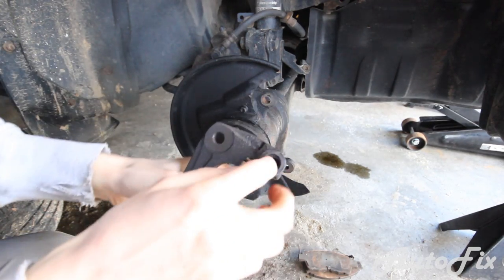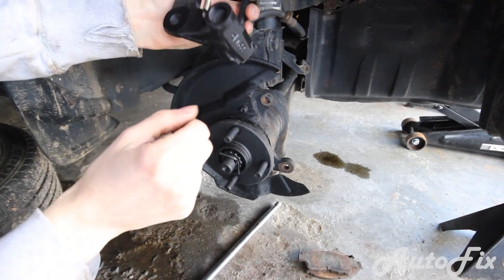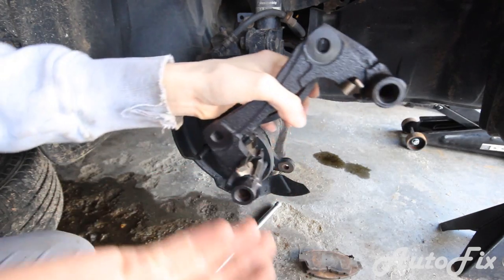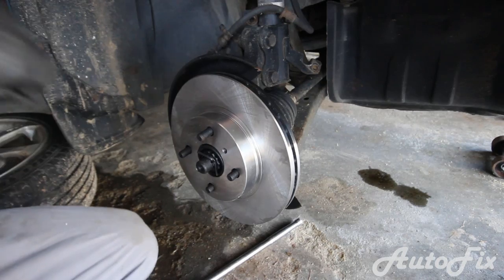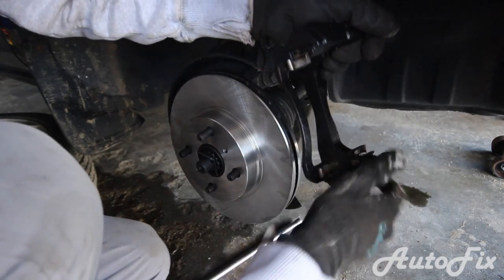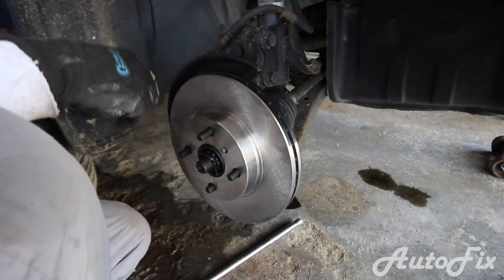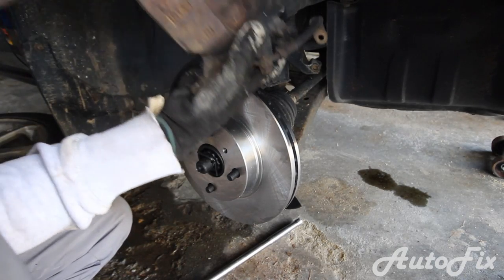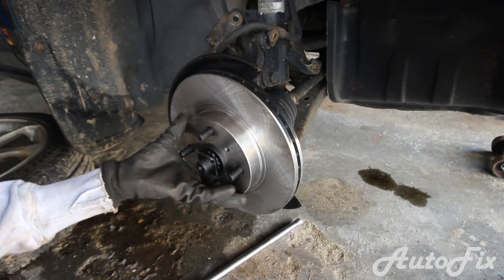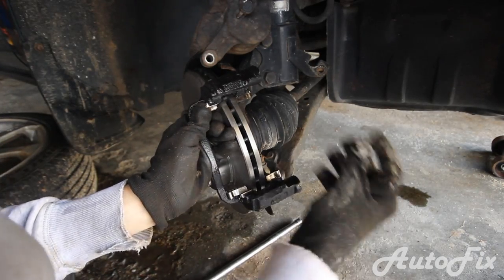Make sure you clean everything up. I used brake cleaner with a little straw shoved in there and cleaned everything up until brake cleaner poured out clear, then painted them. Now it's time to put stuff back on. You've got your rotor back on — make sure you put the right bracket back on. I painted the hub and the bracket; I'll paint the caliper later.